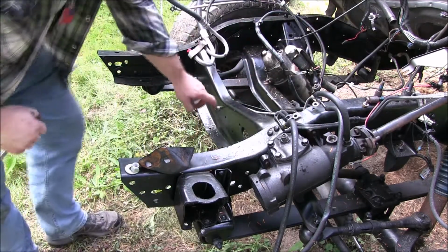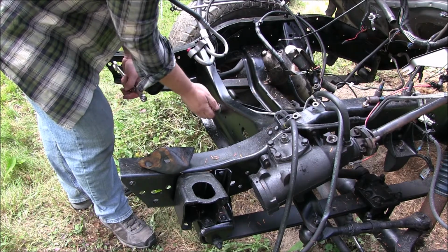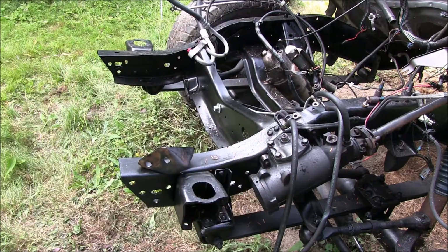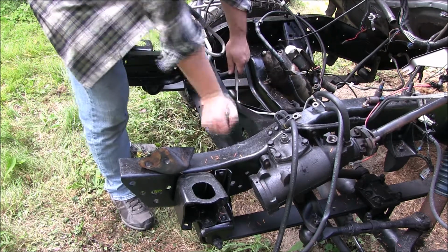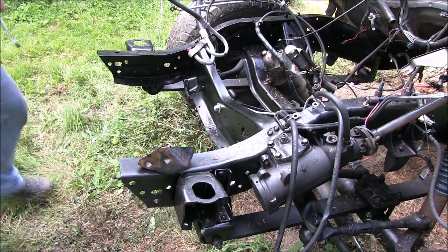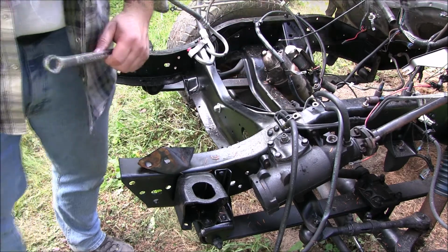Okay, so we are pretty good. We got plenty poking through that side. Got a little bit of a gap there, so that'll suck up. We're almost at the end of our threads. Always tighten from the nut side unless it's called out in the engineering drawing. Look at that, just barely poking through. Alrighty. So for my next trick, we're going to pull these out one at a time, and we're going to get the thread locker on those.